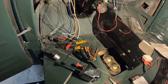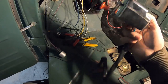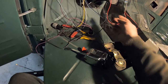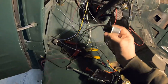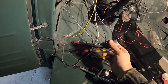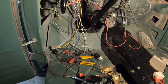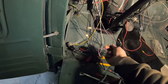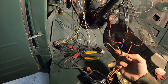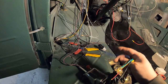If it doesn't work, we'll just replace it with something better. It's from Amazon, it was like 35 to 39 bucks. So I've got to hook it up to my Speedway wiring harness. The Speedway wiring harness gives you a flasher for the hazards and a separate flasher for the turn signals. These are only two-prong flashers. All the wires are labeled and it's seven wires, which matches the Speedway harness.